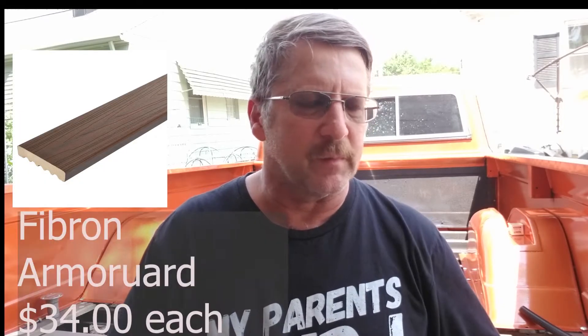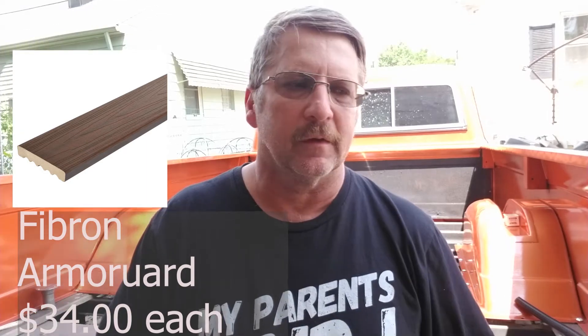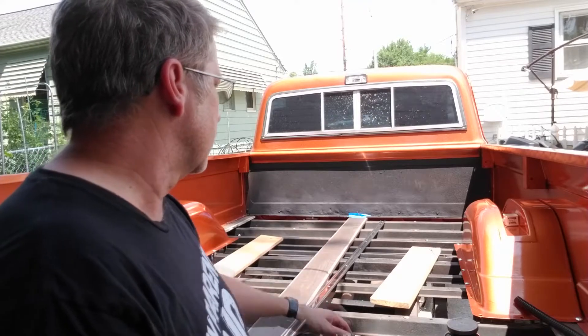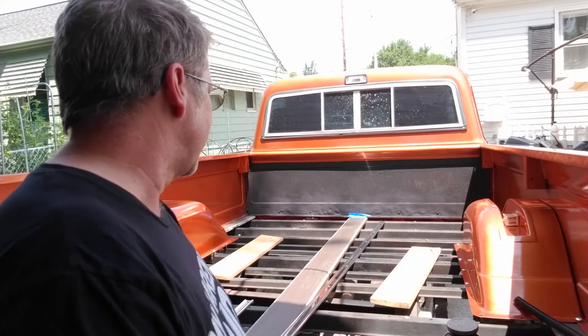I've got the product — I'll post it up here. It's like a Trex-type material, a plastic lumber, so it's not going to fade. It'll sit on people's decks for 20 years and has a long guarantee against fading. The one problem with this material is if you space the supports too far apart, it'll sag and warp — even two feet can cause sagging, especially with something heavy in the truck in the heat. So I've put in a bunch of cross members to support it; the biggest span is about 11 inches, with the rest down to six and eight inches.